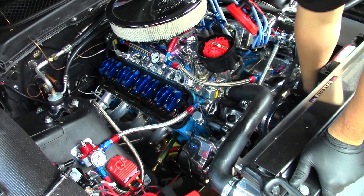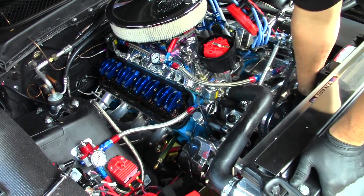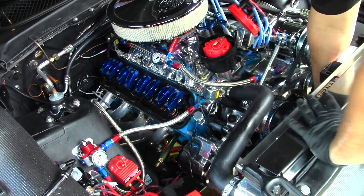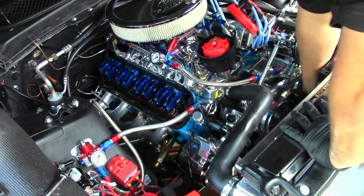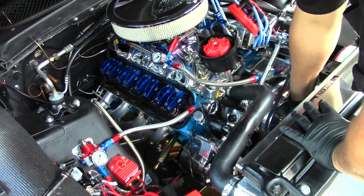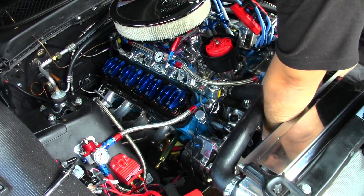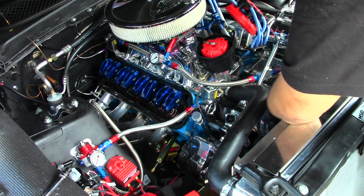So let's keep going around here. Also notice you're going to hear a hissing noise when I get closer to top dead center. Both of our valves are closed at this point — it's getting ready to become compression stroke. Hear that hiss? Now it's starting to come out. And if my wrench doesn't slip off my crank bolt, I can actually show you true TDC, or as good a TDC as you're going to get with this tool. This tool is meant to get you in the ballpark. There it is — now it's starting to fall back down.